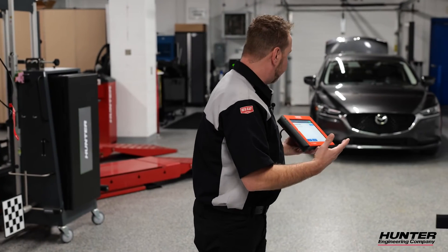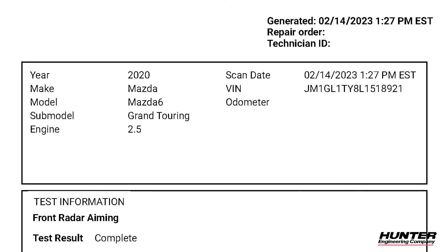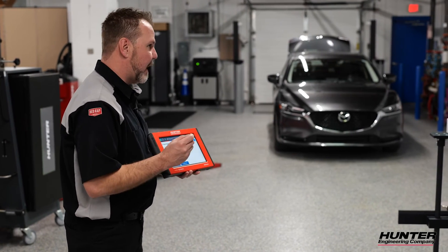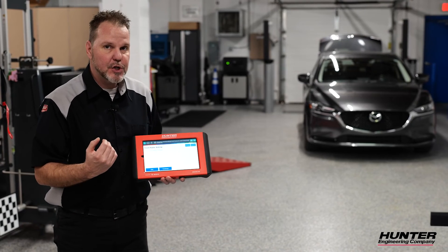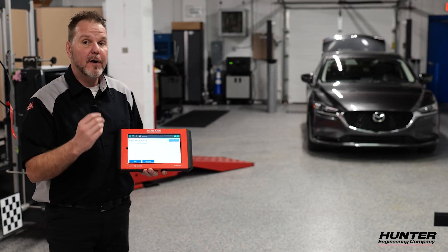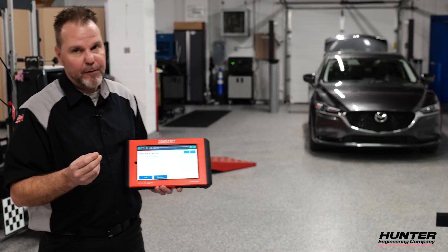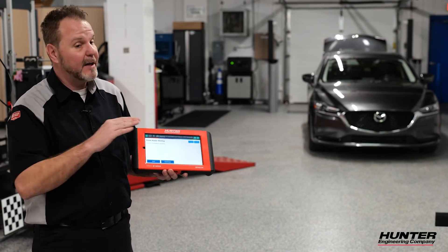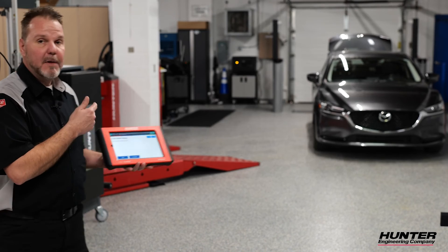Our front radar is calibrated right now. We have a report that is now saved in our ADAS Link showing that the calibration was done. As with any ADAS calibration, your next step is a test drive — verify the system operates as designed and is working in real traffic conditions. Does the vehicle slow down as intended? Does it get too close to the car? Does it maintain distance? These are all very important things, especially on front collision systems. So test drive it, then get your post-scan for your customer as well. Go back in, read your DTCs, verify that there are no other DTCs related to the calibration or anything that you did. Then you have three different reports that you can provide to your customer.